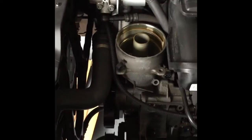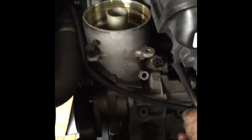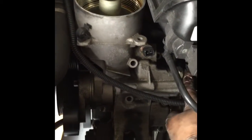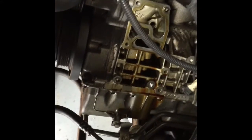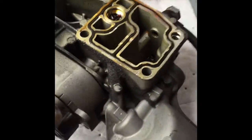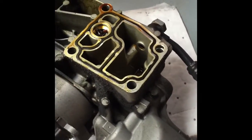Here are the bolts laid out from top to bottom, left and right — one through six. I removed the oil filter, so make sure you cover the opening so nothing drops in there. The electrical connections are off — there were two. Just give the housing a wiggle and it should come right off, and the gasket should be right behind it. Now you can see the whole assembly came off — there'll be some oil, so you want to put rags down. Here's the gasket — just take that off, put the new one on, and we can put everything back together.